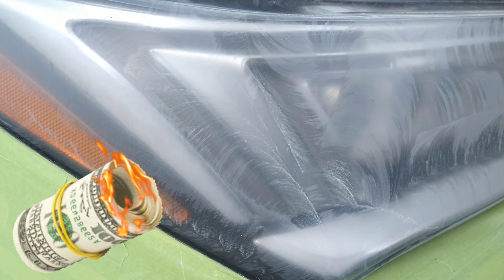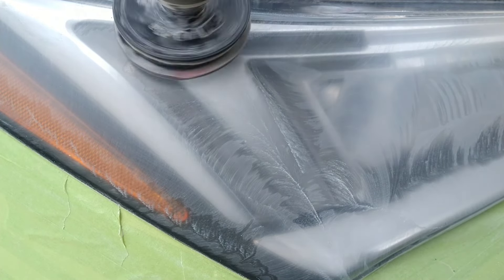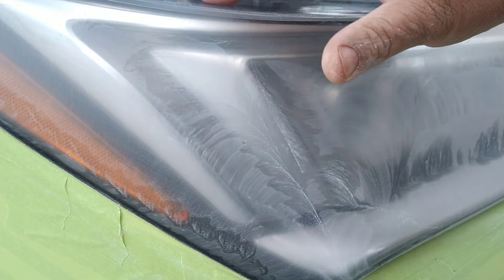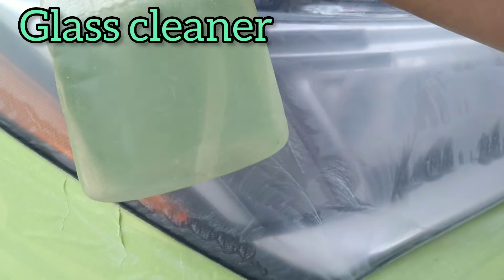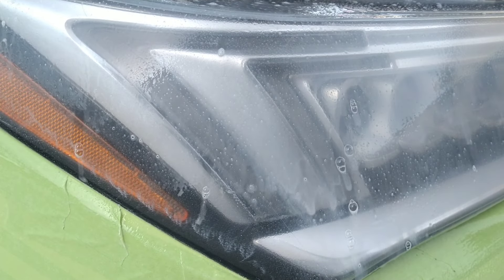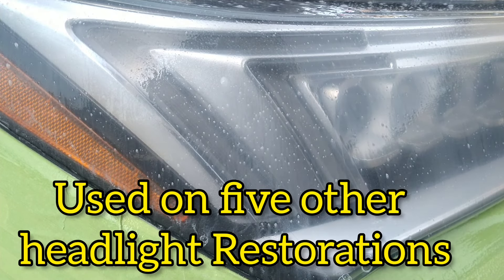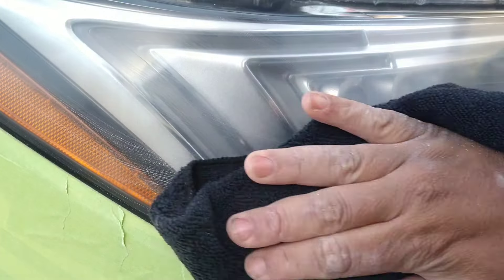The P3000s are the most expensive pads, but they're probably the most important pad to really get rid of those fine scratches. They're essentially a sanding-slash-polishing type pad, designed to erase scratches left behind by the 800 or 500. Keep in mind they're more expensive than the others, but they're the only one you can technically use multiple times. The one I'm using here has been used in about five other headlight restorations.